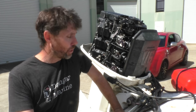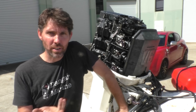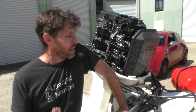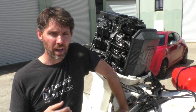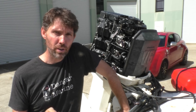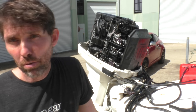I'll pop the battery in and then turn it over with the spark plugs out. I'm going to disconnect the lanyard so that it won't get spark — that way we don't risk burning the coils out or lighting any remaining fuel. The reason I'm going to do that is I figure it may just fire up, and I want to have a listen to it first. If there's any particularly nasty noises, I'd rather investigate them rather than have them drowned out by it firing up and having any potential damage amplified. I'm going to turn the water on too — even though we're not firing it up, as you crank it the impeller is turning so I may as well put a bit of lubrication in there.